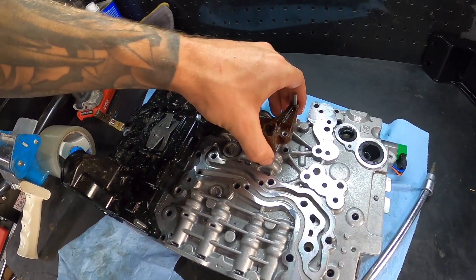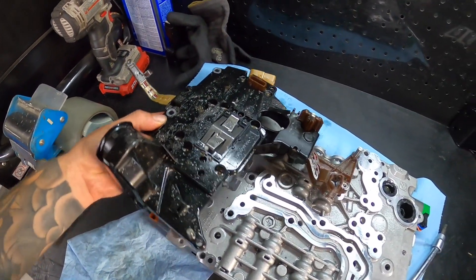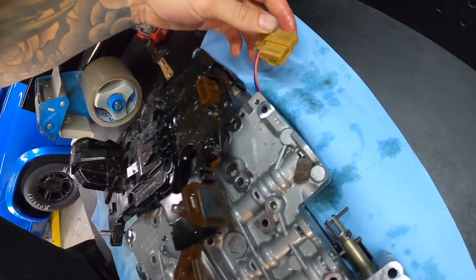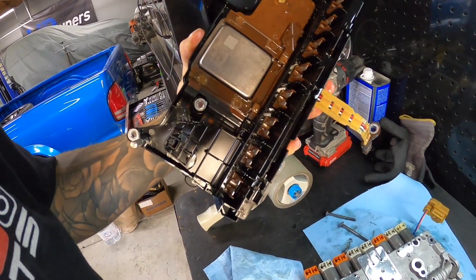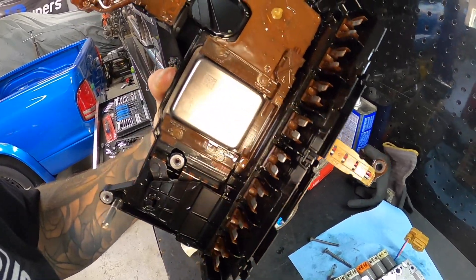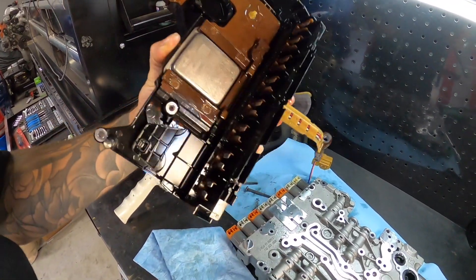And this is your TCM. I don't know if I'm going to be able to salvage this one, because as you can see we've got a sensor broken here and a sensor mauled over here. But this is how you remove it. So the TCM is right there — you can see the brain in the middle. But I don't think I'm going to be able to salvage this, because it looks like this is all one integral unit. Normally you'd be able to swap this all over if obviously everything was good, but mine is not. So I might be stuck.